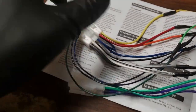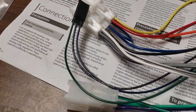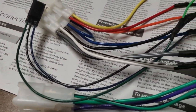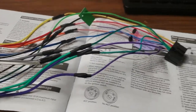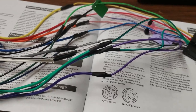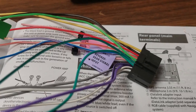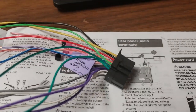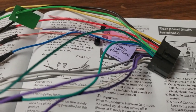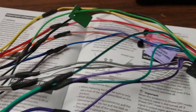The harness is all wired up and I got the bypass in there too. The blue wire goes to your remote, black goes to ground, and the green goes to the parking wire — I've got everything shrink wrapped. I'm gonna put some wire loom on it, but I have one more connection to make: the reverse gear signal input, which I'll need to find on the car using a multimeter.